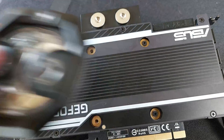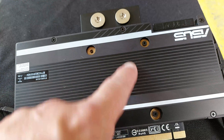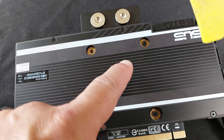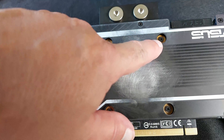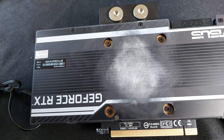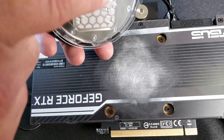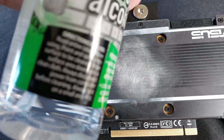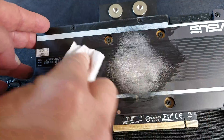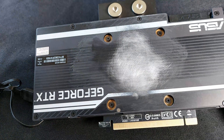So now I know I'm going to put it about there. The next thing I'm going to do is sand off a lot of the material around this region — I'll do that outside. That's because I want to try and get back to as much metal as possible for the heat transfer. The other thing is it'll make a high temperature epoxy resin bond better if it's going metal to metal. I've removed one of the screws to check the size and I've replaced the two screws that were missing in the back. I presume they should be there — not so good on the ASUS build quality side. I've now sanded back the middle area where the rear of the CPU cooler is going to be touching, down to aluminium, and I'm cleaning that off with some isopropyl alcohol so it's all nice and clean. I've given the whole thing a really good blowout to make sure there's no little aluminium particles anywhere in the card or in the crevices.